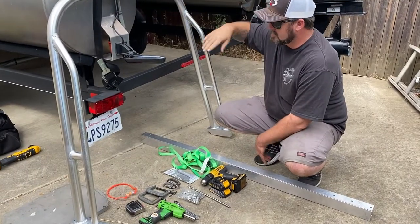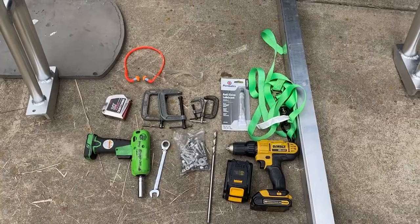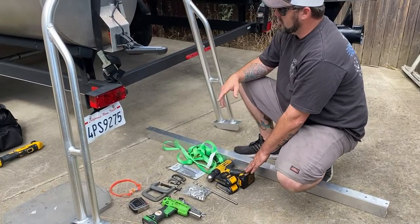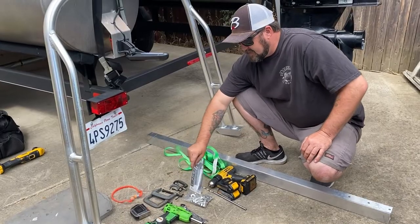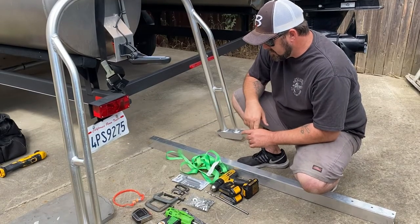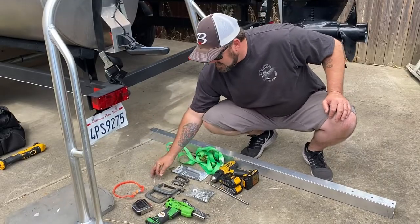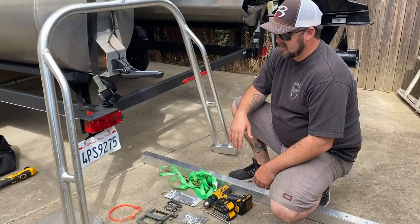As far as tools, you're going to need the ski tow tower kit, which comes with the hardware. It's 9/16 hardware, so you'll need a 9/16 socket and wrench. I like to put it on with an impact — it just makes it easier — but you can use a socket wrench and a regular wrench too. You'll also need a drill and a sharp 3/8 drill bit to drill holes into the supports underneath. You'll need anti-seize for the stainless hardware, at least two C-clamps, a ratchet strap, a tape measure, and I'd recommend eye protection and hearing protection.